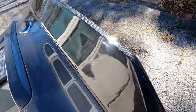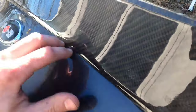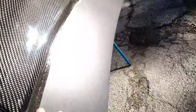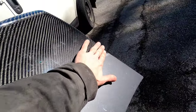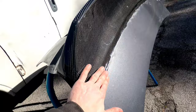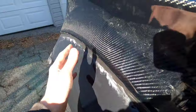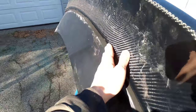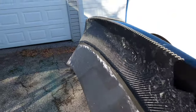I apologize, it's very windy and freezing outside today. So now I'm going to sand all this down — maybe 80 grit then 180 — and then take some fiberglass filler and run a little layer of it all along the edge of everywhere that I put the panel bond. Then hopefully after I sand that down it'll be smooth enough that I can put one nice even coat of regular filler the whole way across, block it down, and be done.